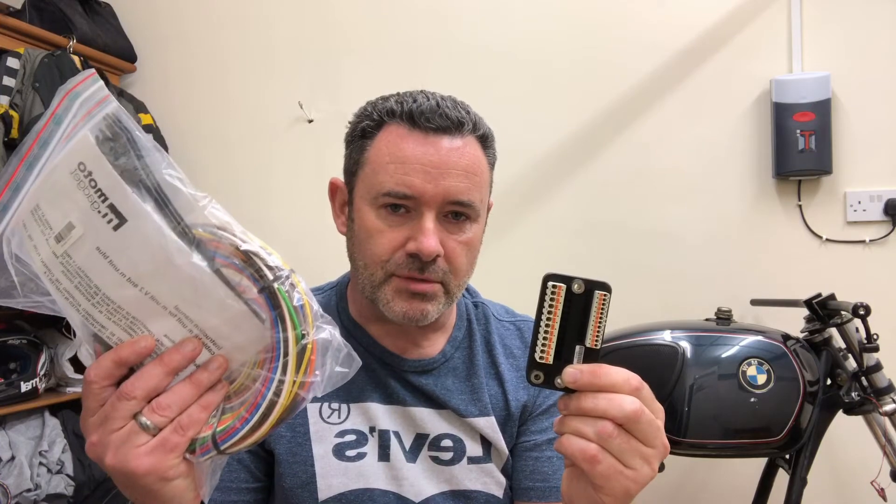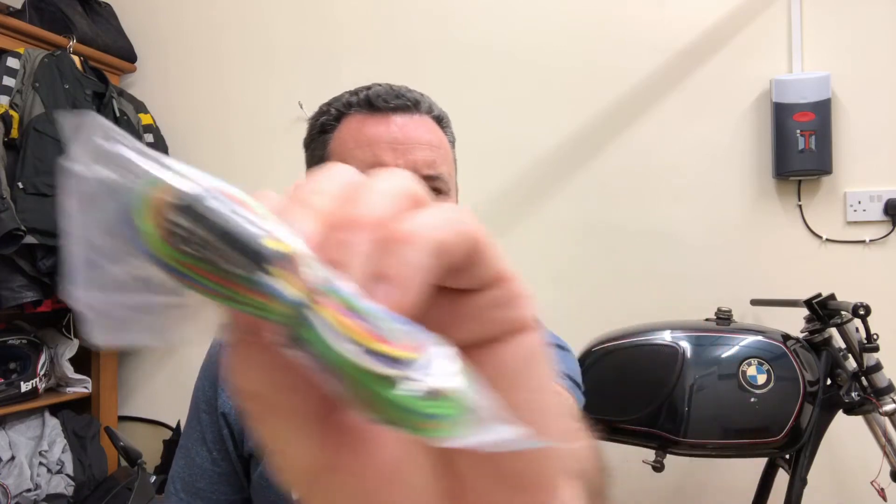For the electrical system I've decided to go with Motor Gadget, and this is the M Unit Blue, which I think is the top end of this kind of stuff — this will be the heart and brains of my machine. It comes with a huge bag of wires which is really good. I've also picked up one of these called an M Button, which is a little controller that allows me to simplify the wiring of all the handlebar controls back to the M Unit Blue.